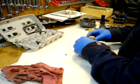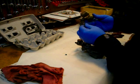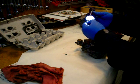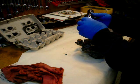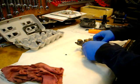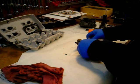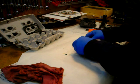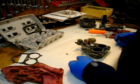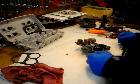There's the brass pin for the float and a little spring. There's the valve — and yeah, that thing is like new. I'm starting to think instead of opening up the rebuild kit, I'll just be careful with the gaskets and put the whole thing back together, as long as the gaskets are fine. I haven't come across anything that would make me question it continuing to run nice.